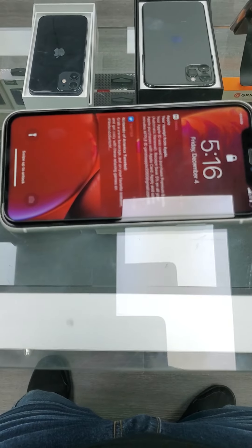Now putting this final tray on — that should be it. Put the pentalobe screws back in; don't forget that, because I have forgotten before. A lot of people like to test the screen first, but I know it's good unless you have a faulty part. We finish it off by putting a screen protector on it. I keep the fresh screen protector film on from the new screen replacement, grab my little credit card tool to get out any air bubbles, pull the backing off the screen protector, and put it on immediately. Voila — perfect.